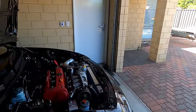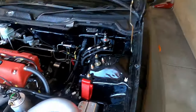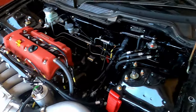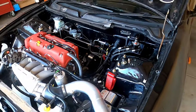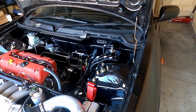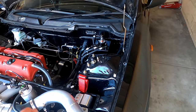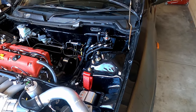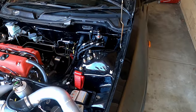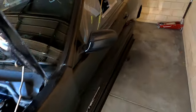The fuel tank and fuel system are all back in — pretty straightforward, everything popped in nicely. What I need to do now is prime the fuel system and check for leaks. There are two stages to this. First I need to fill the surge tank up, because if I turn both pumps on with the fuel pump button on the keypad, the main pump will run dry for ages, which is not good for it. I'll show you how we do that in the Haltech software.